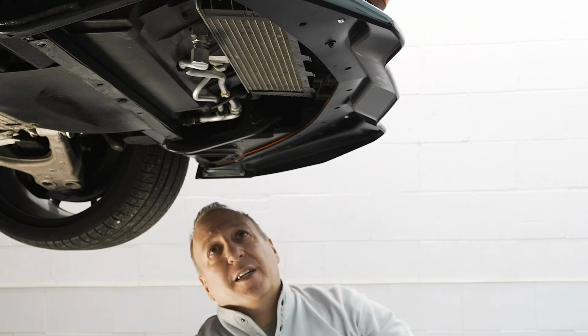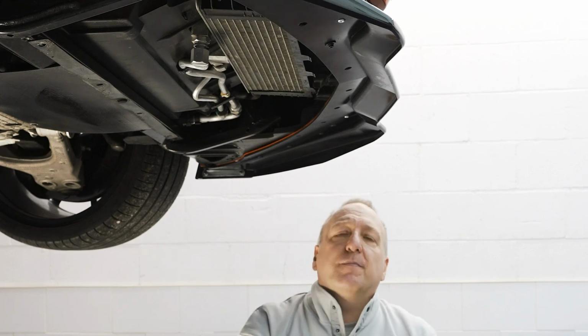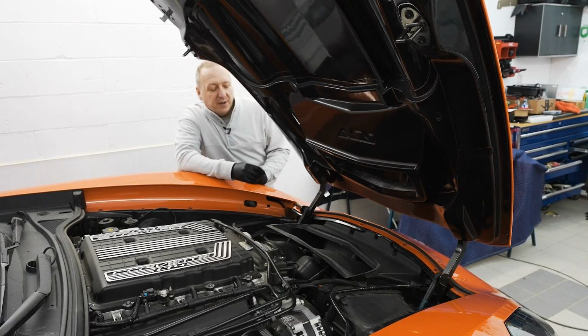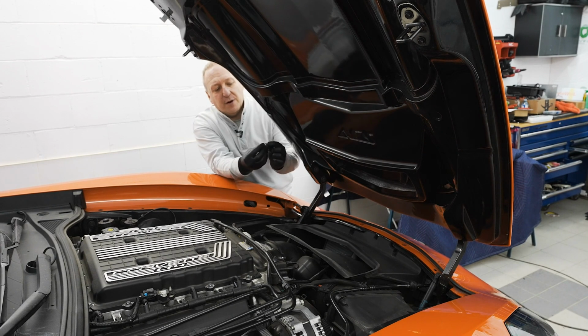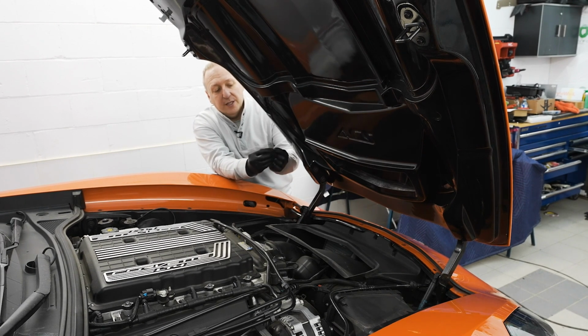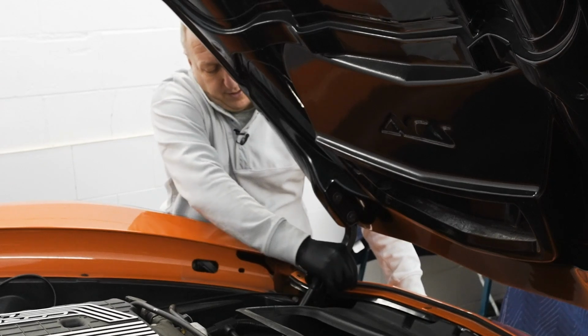We're going to move back to the top of the bumper, put all those fasteners back on, and then button up the bottom. We're moving on to the top leading edge of the bumper. We have our scrivets, which is basically a plastic rivet with a nail. A lot of times these fall apart. If they do, there's only one way they go in. Keep it open, line up your second mounting hole.